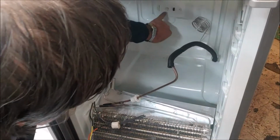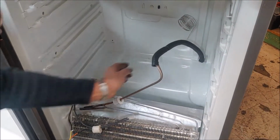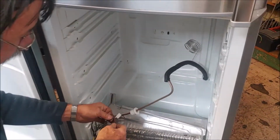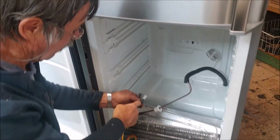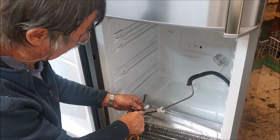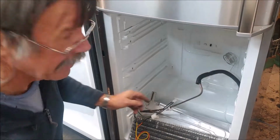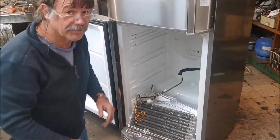Now there's all these little plugs here that were used for the fan, for the element, and it had a whole lot of other wires. So all I really need is 3 wires to come to the top. The element and the fan motor, so that I can use a common, like a neutral, to the element and to the fan, and 1 wire for defrost for your element and 1 for your fan. So I'll put this tray together and then hang the wires out the back, and then I will show you what I've done behind the fridge and we'll link it up to those.